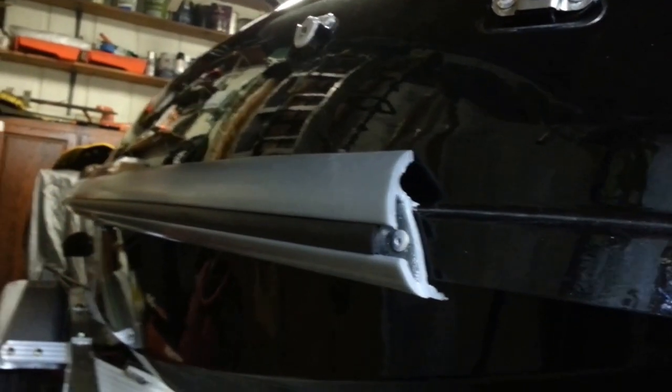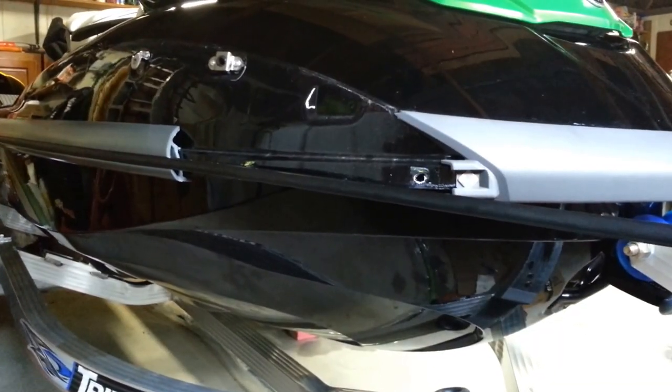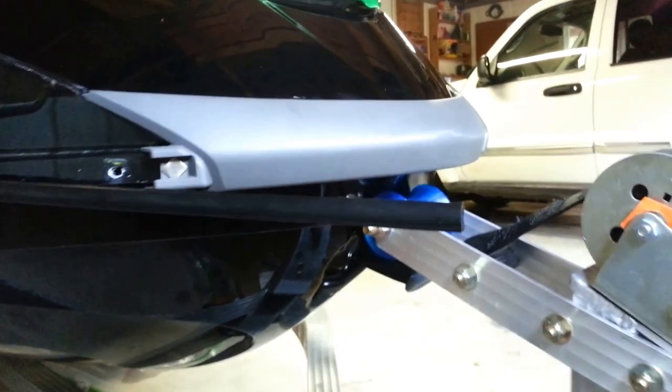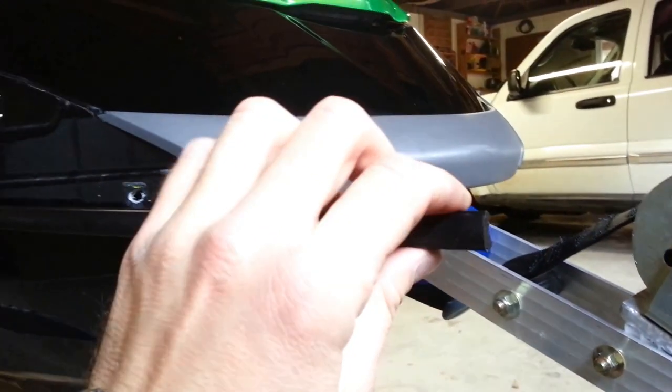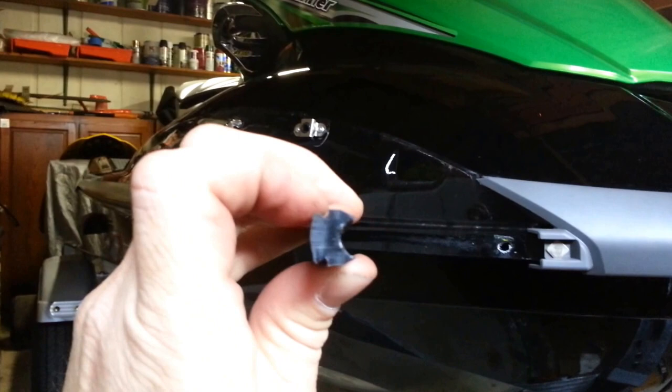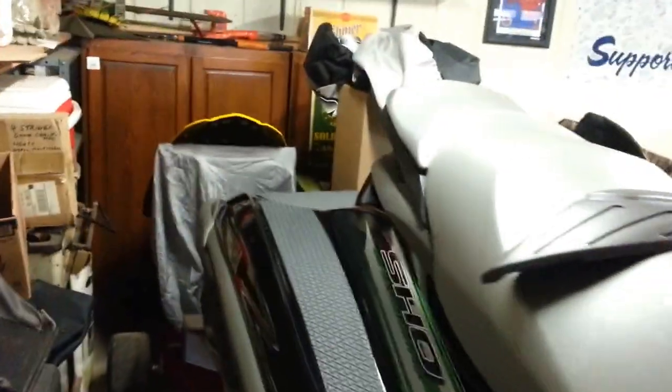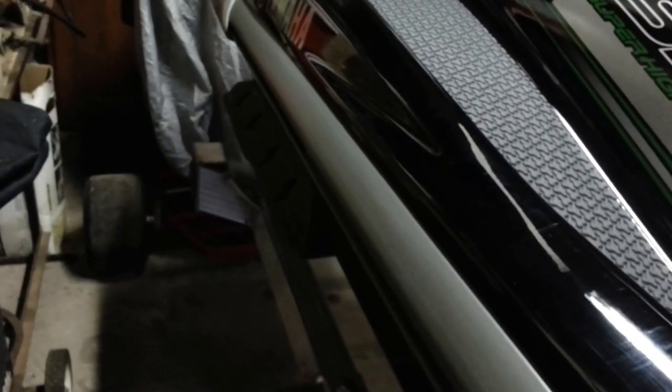I'm going to start pulling this out. So I've started pulling this out — unfortunately it's black on black right now, so it may be hard to see. But this here is the inner gunwale I was talking about earlier, and you can see from the design that it kind of fits like a channel into that outer bumper. When you start pulling this out, it'll just start sliding out from behind the rear corner cover. Basically the end of it is right here, so it'll slide all the way out, and then we can get ready to start sliding in the new piece.